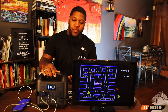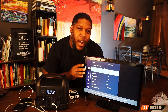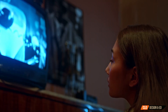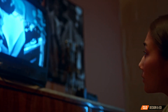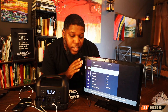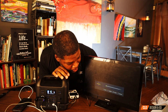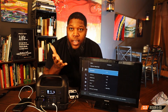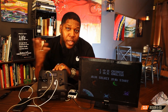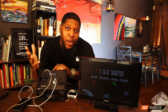And we've only gone down 1% on our battery pack — from 96 to 95%. One thing I wanted to point out: in the menu of your TV, there's a setting called the backlight, available on every modern LCD, plasma, or 4K TV. If you want to extend the range of your portable battery pack, you can adjust this setting. We're going to go into the settings — right now it's on 12, which is in the middle. If I go all the way down to zero, we can still see the TV somewhat, and it went from a solid 10 watts down to seven watts. So by turning it all the way down, we save three watts and still watch TV, gaining two more hours — from 15 to 17 hours — just by turning down the backlight.